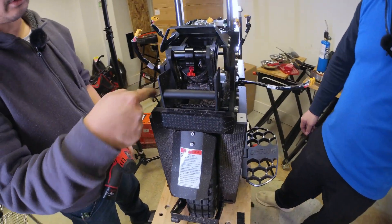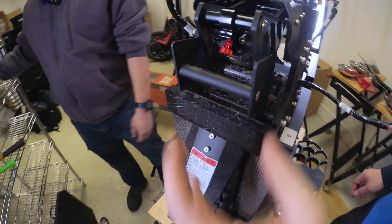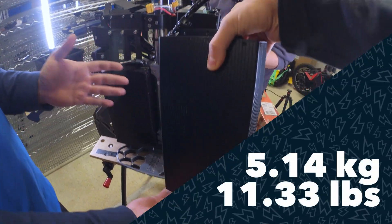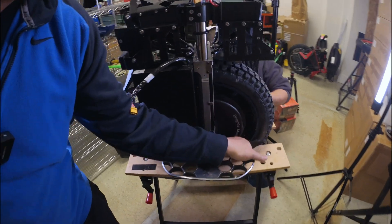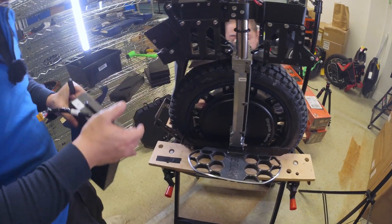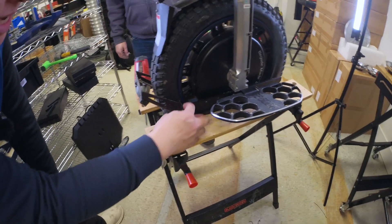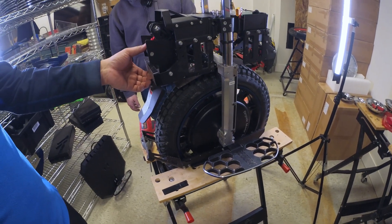The battery brackets are now tied together with metal - this acts as a lift bar, but also provides structural rigidity as a bridge between the two sides. Each battery pack is 5.13 kilos, which is quite heavy. At the bottom, there's a double-thick spacer compared to the Master Pro. Importantly, Bagode added a plate here so the battery has a flat surface and there's no sharp corner on the kickstand that could puncture the battery - the Master didn't have this plate, so if the kickstand got kicked in it would just crunch the battery. They definitely thought this one through a lot more.